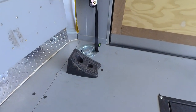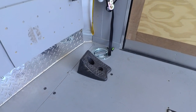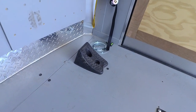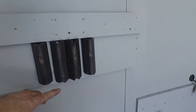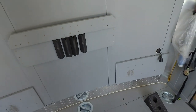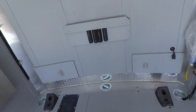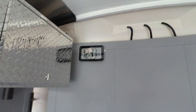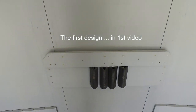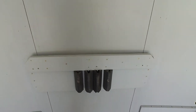I run the side-by-side up against wheel chocks which give me the exact distance I need from the front. But if I slam on the brakes the side-by-side would want to climb up the chocks, so I use a tie-down from the floor through the front bumper to keep it level. That way only the suspension compresses and the vehicle doesn't roll forward. There's also a small wood piece across the top I added from leftover material — it gives me a place to hang the tie-down when wrapping around the front bumper.